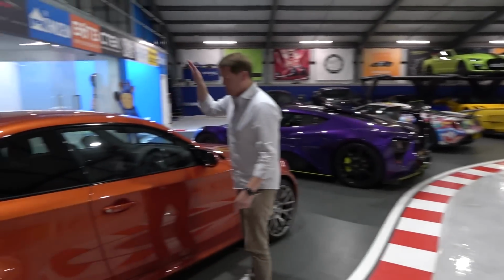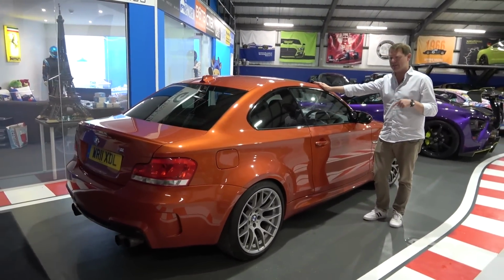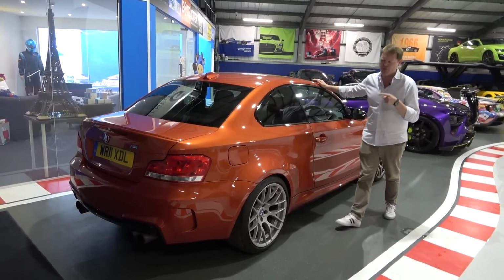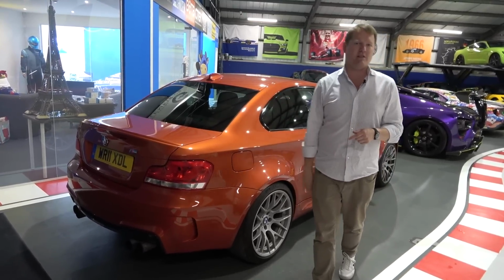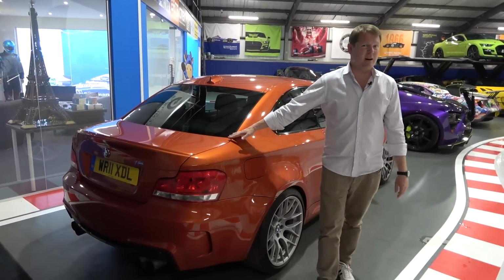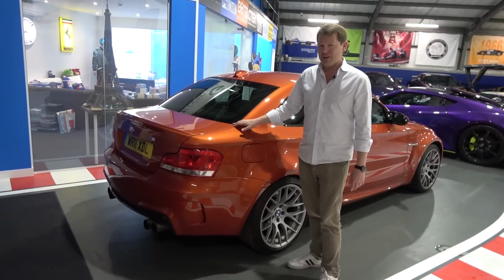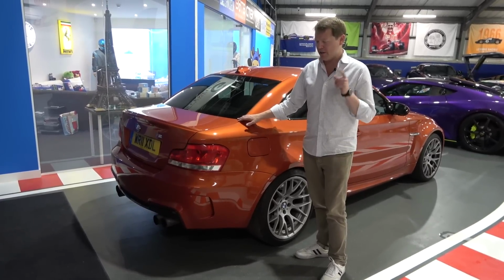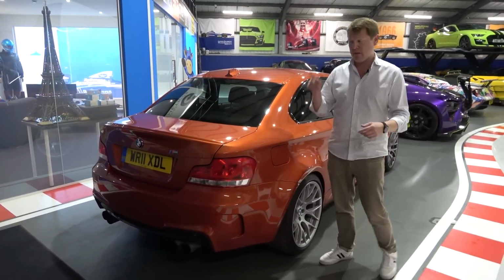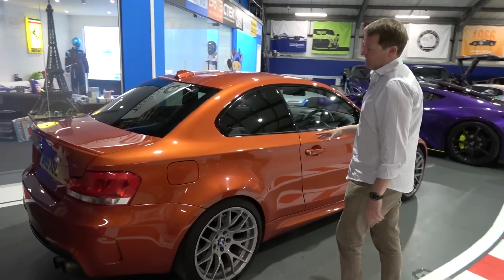Today, though, was, of course, about this, and it's such a fun thing to drive. And what's interesting is, even doing some more miles in it today, the diff even now feels like it's getting back into the flow. It's driven very few miles in the last 12 months. Obviously, over the last couple of years, very few anyway. But the last 12 months, I think it was like a couple of hundred max. So probably just the oils and fluids sitting still for too long have basically caused it to get a bit clunky, but it feels like it's loosening up once it goes through the cycle. So maybe a diff oil change will be the trick for that. Obviously it needs a service, all of those kind of things are going to be coming.